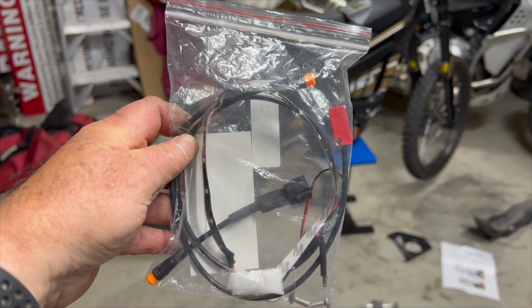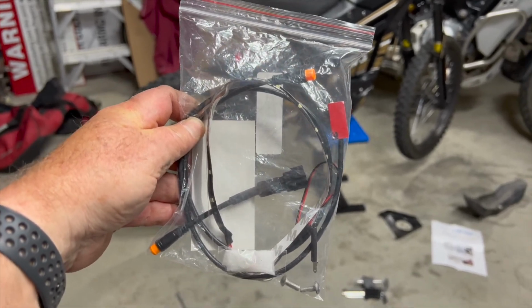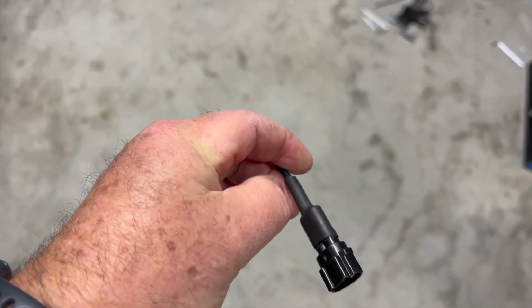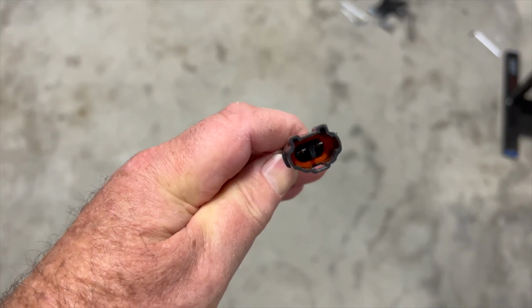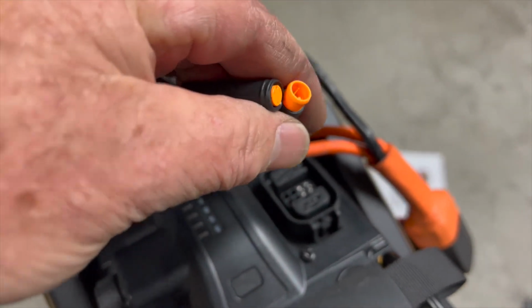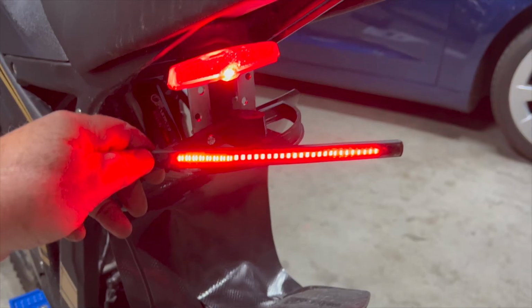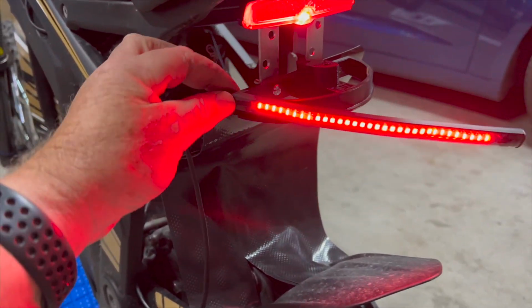Fortunately, I haven't modified my brakes, so I was able to use the other half of the adapter kit, which plugs into the orange connector at one end and plugs into the front brake wiring harness at the other end. This then uses the factory-fitted brake sensor.